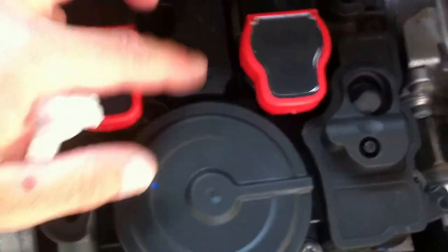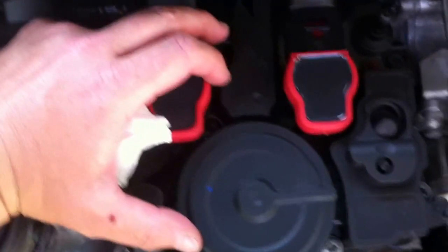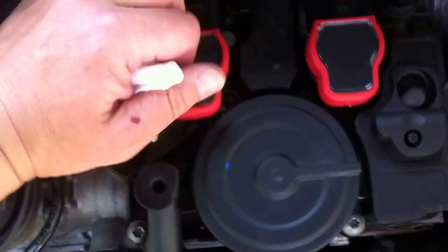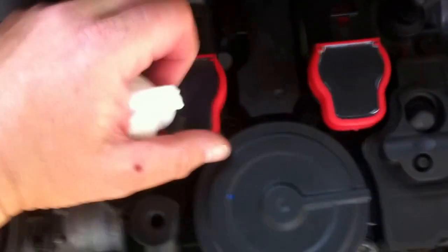I think this is just basically a horrible design. It's a huge chunk of plastic. It could get twisted easily if it's not torqued to spec correctly and in the right sequence. The interface is plastic to aluminum.